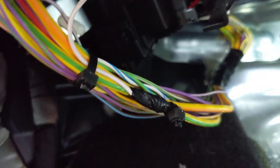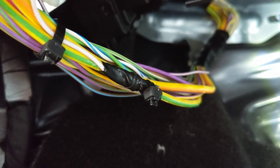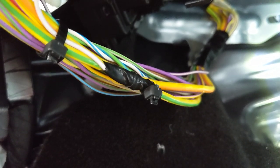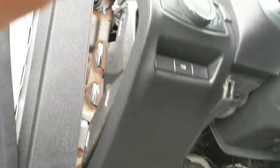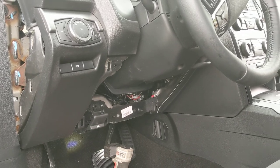But there it is — this is the only ignition wire I could find after an hour. It's in an unwrapped harness and I should have just gone here first. I thought they'd all be 12 volts, but this yellow with green is ignition — it's not an accessory. Hopefully I remember that, because every time I work on one of these I can never seem to remember, so hopefully I save you guys some grief too.